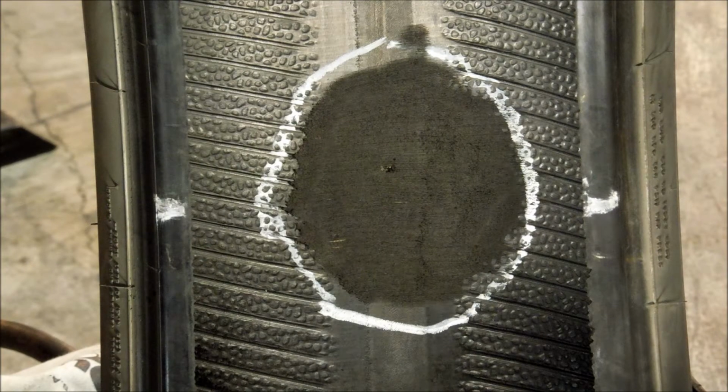Use a vacuum or wire brush and remove any buffing debris from the inner liner surface within the marked area. Do not use compressed air or an airline to blow debris from the surface. Airlines may contain oil and moisture combined with the air pressure that can further enhance contamination, causing the repair unit to fail.